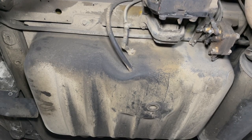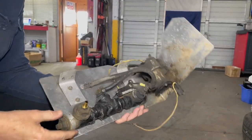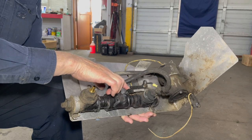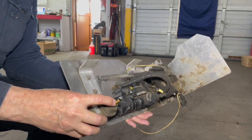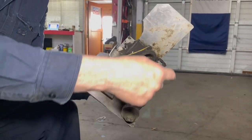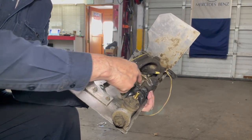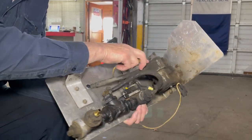The solution I came up with years ago was to create a cast iron sump like this that is heated by a glow plug. There's the glow plug, and here's a thermostat which will shut off the glow plug when it gets too hot. Here's where the fuel comes out — I've got about a two or three inch hose from the tank on the wagon. It goes right into this end of the cast iron sump, is heated along this side, and then exits at the top of the sump into this electric fuel pump.